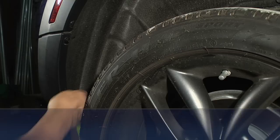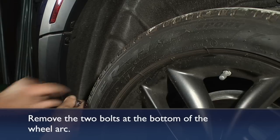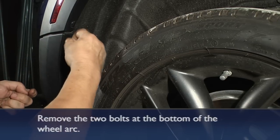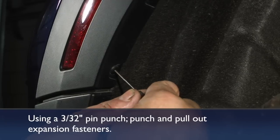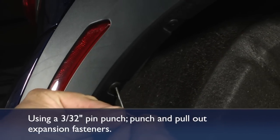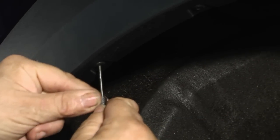The first step is to remove the rear bumper cover. We start in the rear wheel well, taking fasteners loose. The hex screws are removed first — those require a 10 millimeter socket. Then use a small 3/32 pin punch and push the pins on through. Be careful as you take this apart; you want to find your pins and keep them all in a nice parts tray.